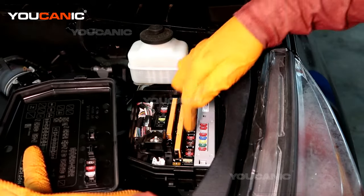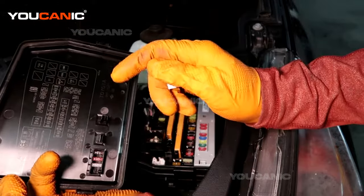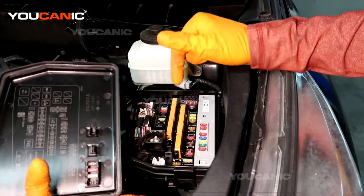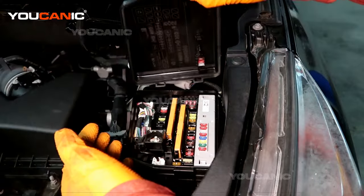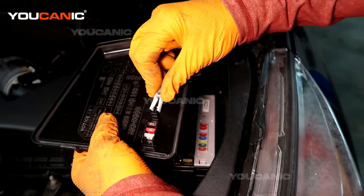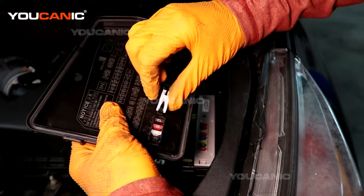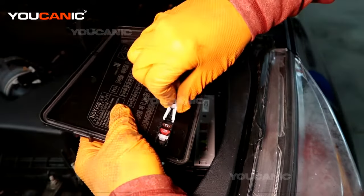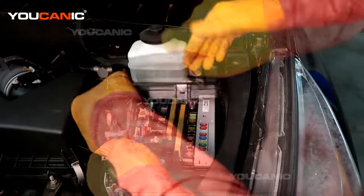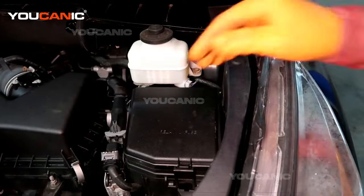We don't change the size of the fuse. Replace it with a new one but don't go larger, because it's supposed to blow at a certain point and if it doesn't, you can cause other issues. So that's the fuse box on the left hand side of the engine bay. Just line the tabs up in the back and snap it together once you've gone ahead and replaced what fuses you need.